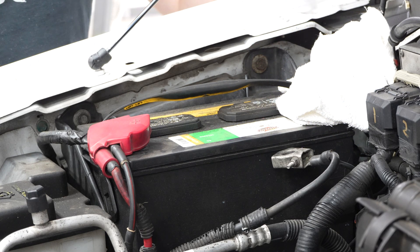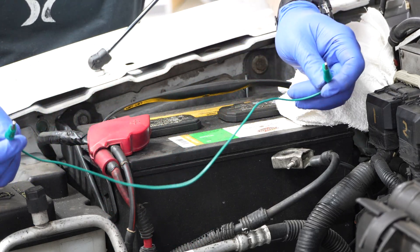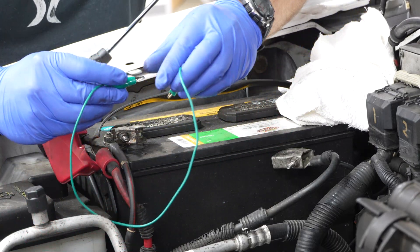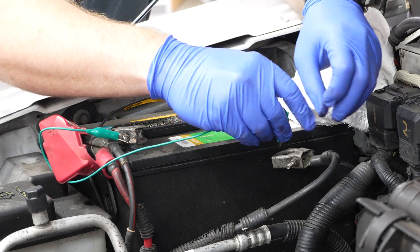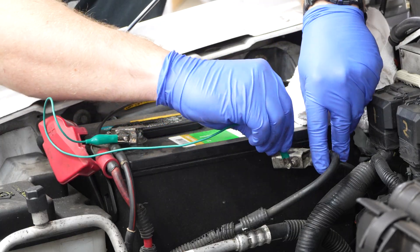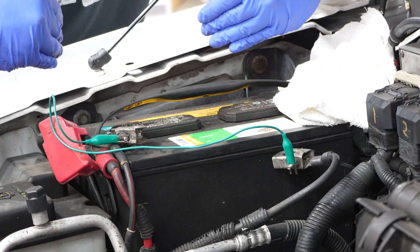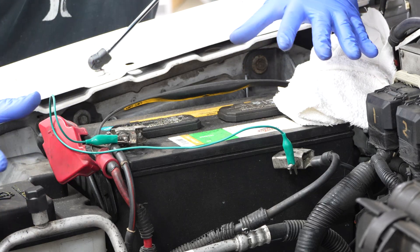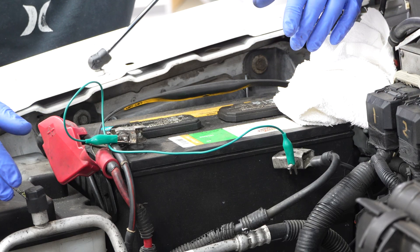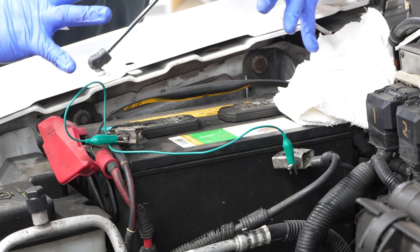Then we're going to grab a wire — it doesn't have to be very robust. I just have this one I got off Amazon with two alligator clips, linked below in the description. What we can do is connect it to the positive side and then to the negative side. Note you are not touching the negative post on the battery, just the cable on the truck side or car side. What this is doing right now is literally pulling all the electricity, all of the capacitors, all the memory down and out of the ECM — which this one happens to be right here — and the BCM and any other modules that your car might have or might be having a little bit of a problem. This will force it to go back to its factory setting, so it's going to have to relearn everything.